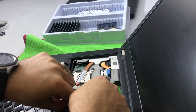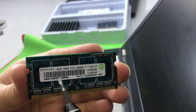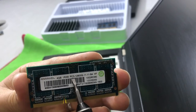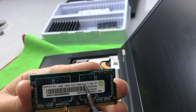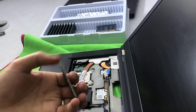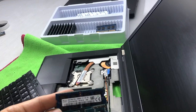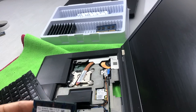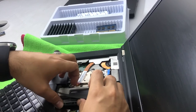I'm removing the RAM from the second slot to confirm how much is in there — it's 4GB. The RAM required for the Lenovo T430 is PC3 — not PC3L — and it ends with an S: PC3-12800S. The new 4GB RAM I'm using is exactly the same spec. 1R versus 2R doesn't matter as long as the frequency matches, and in this case it's both PC3, so they'll work.